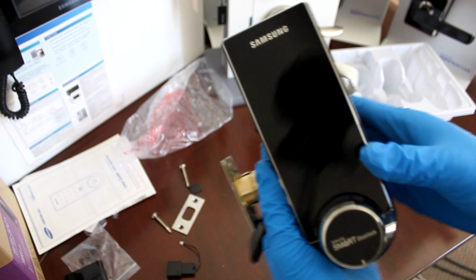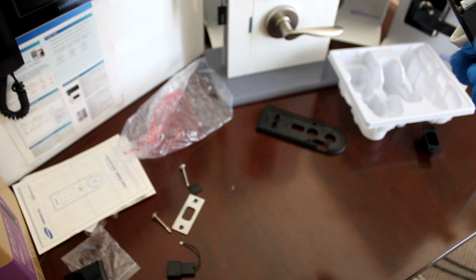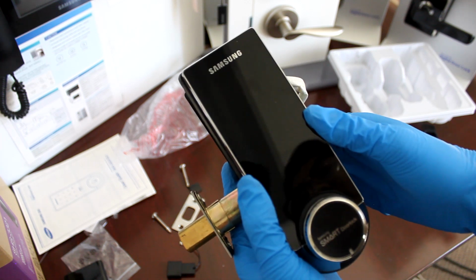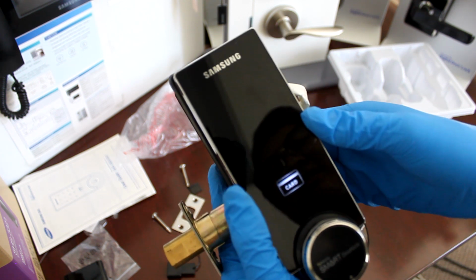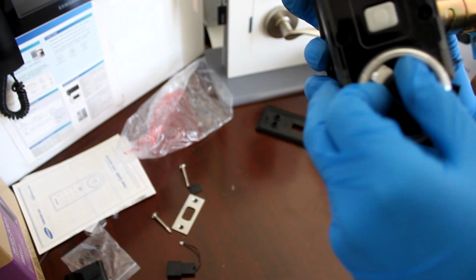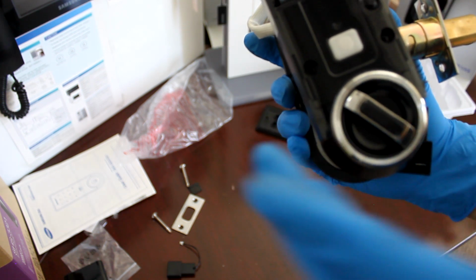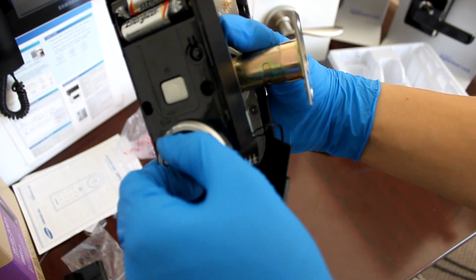And the other troubleshooting is one of these. Oh, I installed my door lock, but it keeps making this weird noise, and it feels like the gears are retracting and blah blah blah, and it's not working. One of the main problems of this is that your door turn knob is retracted while, I'll just show you, it can't lock because it's already in the locked position while your turn knob was turned unlocked. So lock it, put it back on, and make sure it retracts.